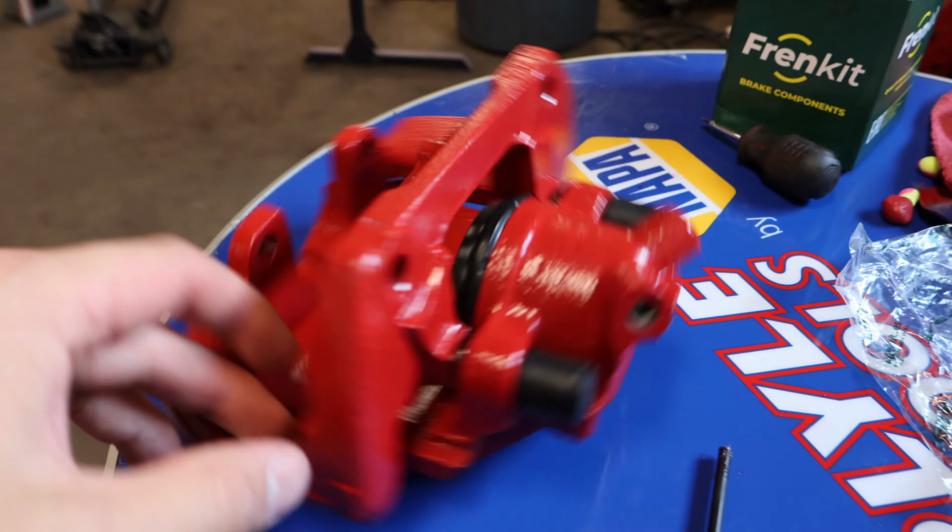And look at that, beautiful, freshly gasketed, fresh pistons. Everything is beautiful. I can't run the fronts yet though because I don't have 17s. In order to run 330 fronts, you need to have 17-inch wheels, which, like I just mentioned, I don't have. The plan is for this winter we're gonna go up in wheels and do some other things, so I figured because I was doing the rear anyways off the car, I might as well do the front. So they'll stay assembled. I literally have pads and rotors for the front too. They're done, just ready to throw in the car. So that's good.